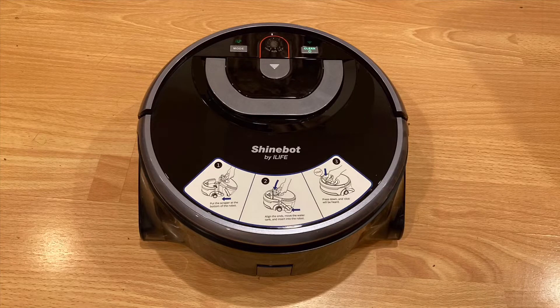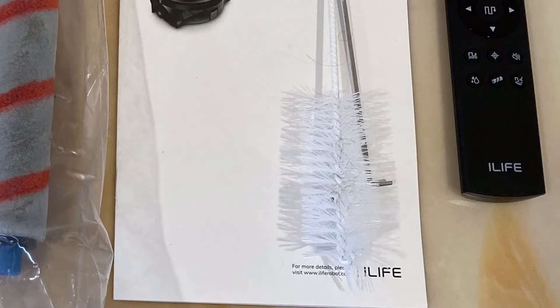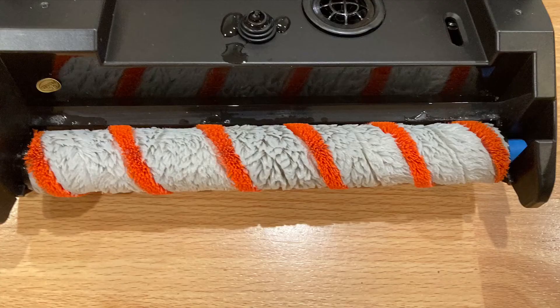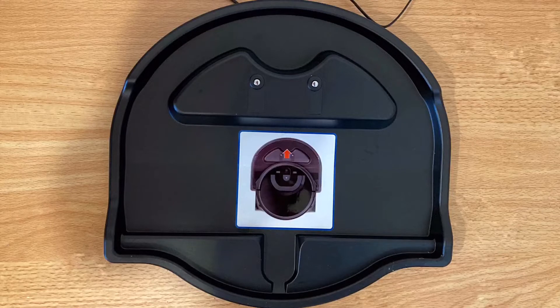Probably the biggest part of maintaining the robot is the brush roll. To clean the brush roll, it comes with a cleaning tool. I cleaned the brush by running the tool through the roll brush for a couple of minutes. After that, all the hair that was tangled got pushed to the side and I could easily remove it. Then I ran the brush roll under water and let it air dry. Then I put the two robot pieces together and took it to its charging cradle.